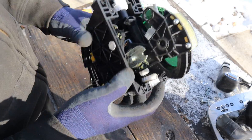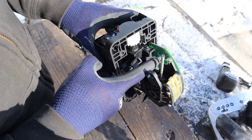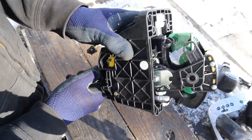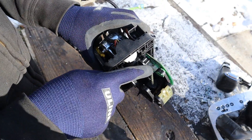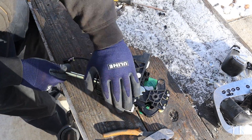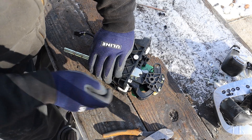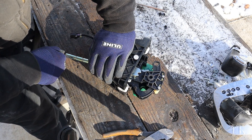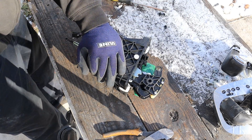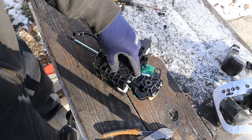You can see these two white gears on the outside here form the pivot axis when you move from drive to manual mode. Now once you are in manual mode, this piece and this piece over here are what's going to move back and forth along with the shifter. As you shift your gears plus and minus, that has no relationship to the position of the shifter rod. There's another axis by this pivot point here, which is the normal one — it's going to rotate this entire assembly back and forth into park, reverse, neutral, and drive. So in manual mode, it's these forks here that move back and forth, but for park, reverse, neutral, and drive, it's this entire thing that moves, and therefore the shifter rod is going to be moving. The shifter rod only controls the direction, but your actual gears — because this is a DSG — are only controlled by these electronically.